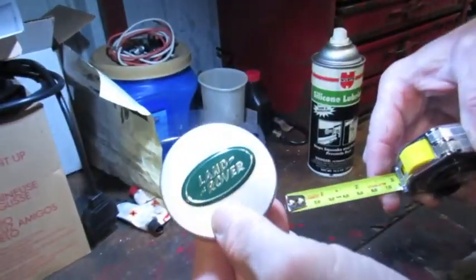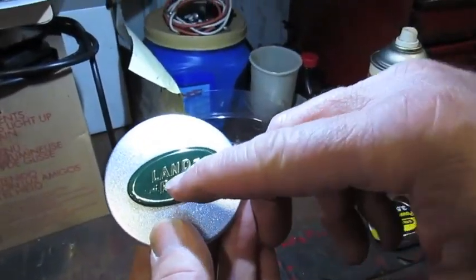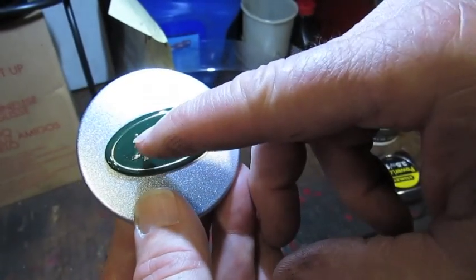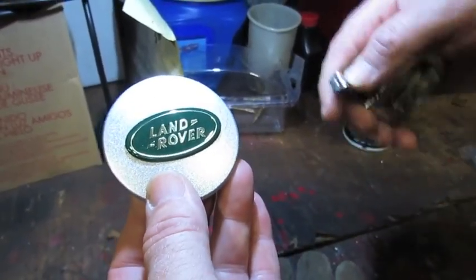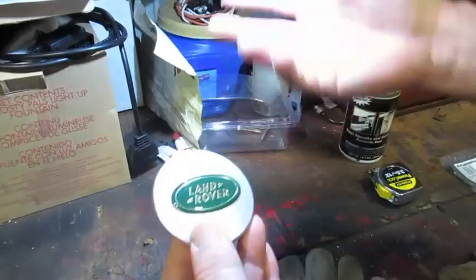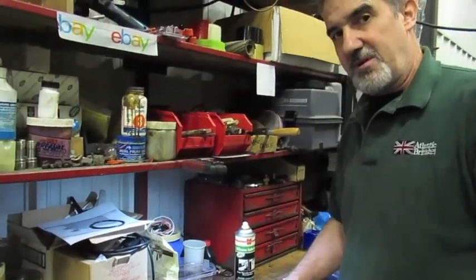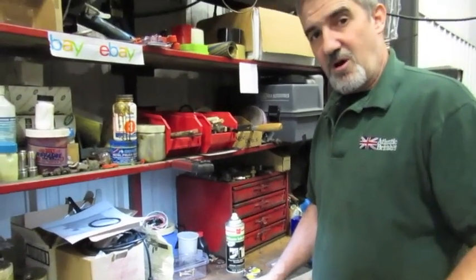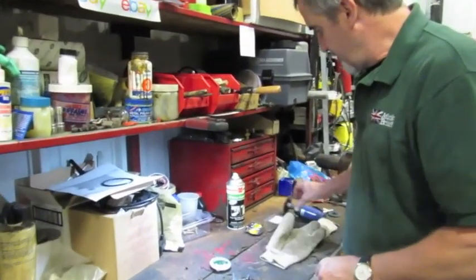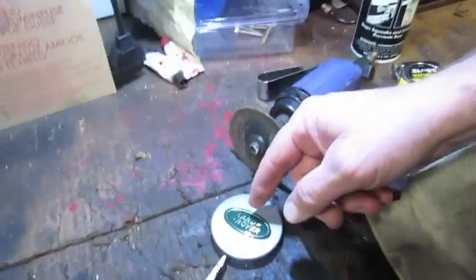You're going to need a tape measure that measures in both metric and American, because the programming is done in metric — millimeters. It just turns out that where it says 'Land Rover' dead center in that line is the center of the wheel. So what we're going to do is cut a slot in the cap so that we can fit the tab of the tape measure into the slot — that will put us in the center of the wheel and we can do an accurate measurement. With this programming and Land Rover software, you have to be within three millimeters of its pre-programmed height, so if you're off, it's going to make you do this over and over again. I'm going to use a cutoff tool — air powered — and just cut a slot in there. You could use a hacksaw or scribe a line with a sharp blade.